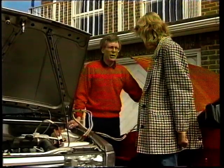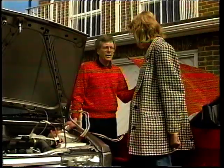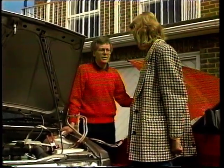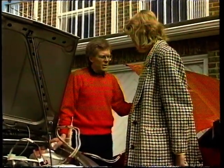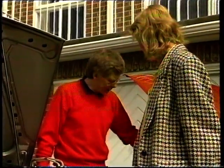This car must be running, and preferably, if somebody is with you doing it, allow it to what we call fast idle, just slightly faster running than at idle speed. You know, about, say, a quarter throttle, so that there's a good lot of energy coming from the alternator of this car into this battery, giving your car a good firm start.